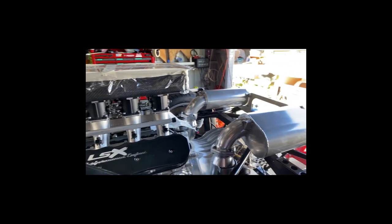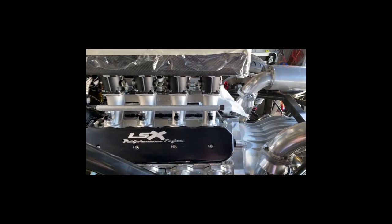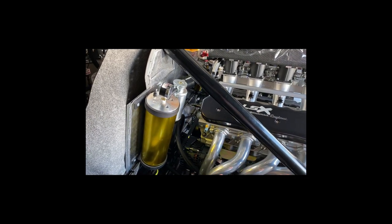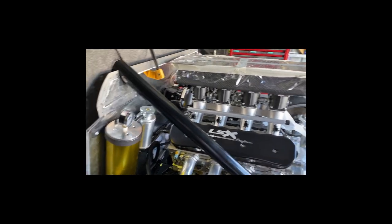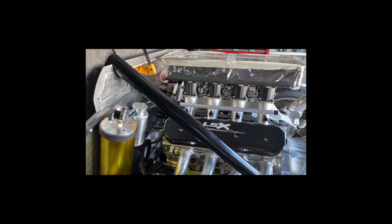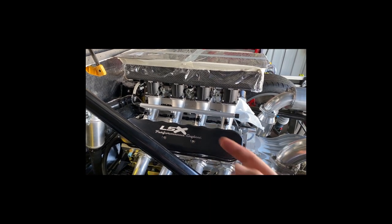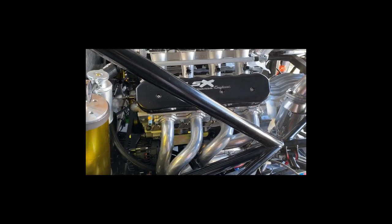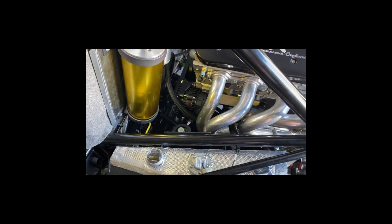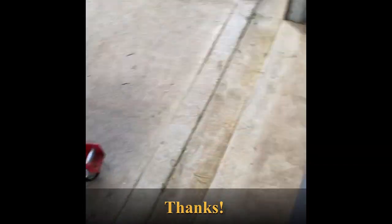There are a lot of little things you sort of forget need to be done, but the exhausts are in and we're making some inroads, which is nice. I can't wait to fire this thing up. Because of the electric water pump I'll be able to pressurize the fuel and coolant systems and get them flowing fluid before I even fire it up — so I can deal with any leaks ahead of time. When we do fire it up, the main things to pay attention to will be air leaks in the ITB system — I can use smoke for that — and the oil lines, which I'll inspect after removing all the floor pan for adequate access.